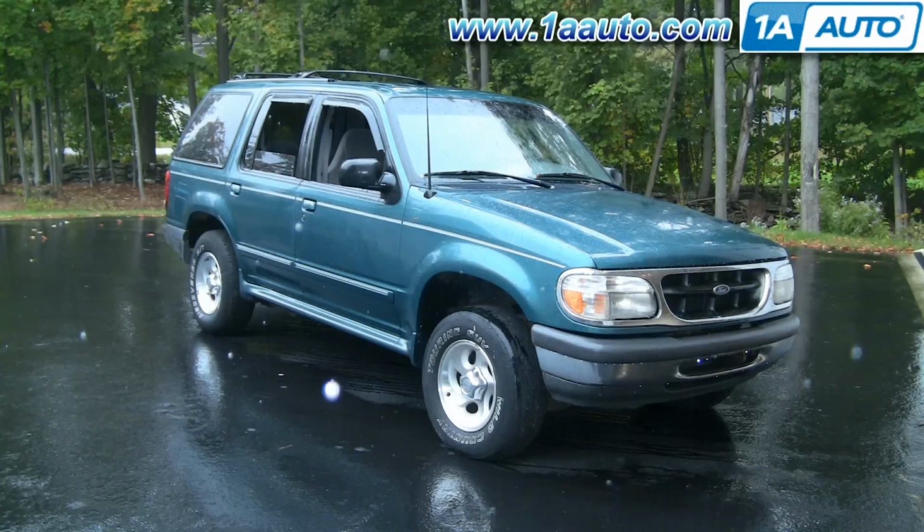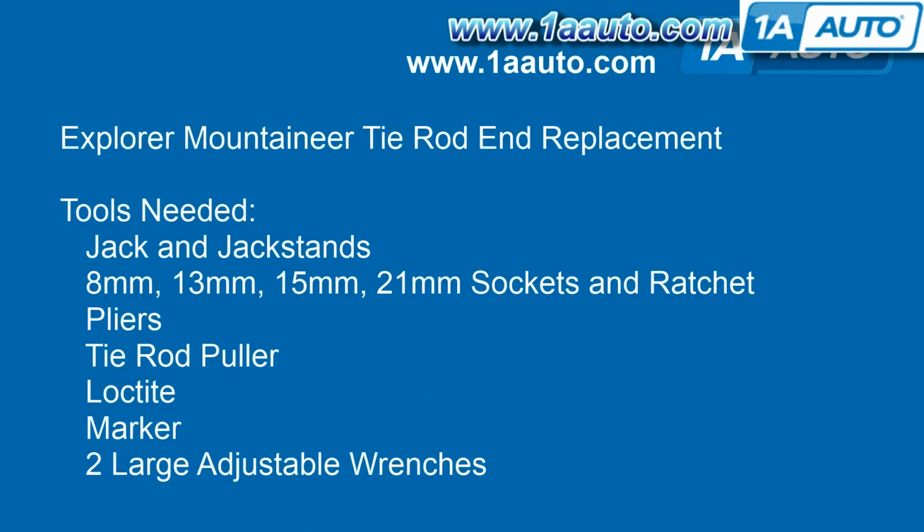In this video, we'll be replacing the tie rod in this 98 Explorer, same as any 95 to 01 Explorer, Navajo, and Ranger, Mazda B-Series pickup. And really, this procedure is similar for most cars. Tools you'll need on an Explorer: jack and jack stands, 8, 13, 15, 19, which I forgot there, 21mm sockets and ratchet, pliers, a tie rod puller, which is the right way to do it. You can use a hammer, but you have to be careful. Loctite, a red or black marker, and 2 large adjustable wrenches.